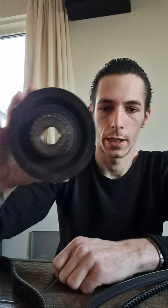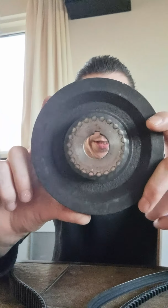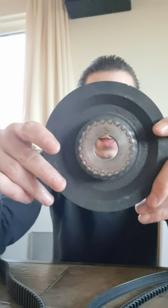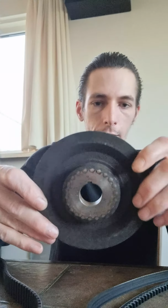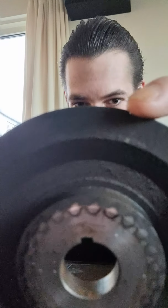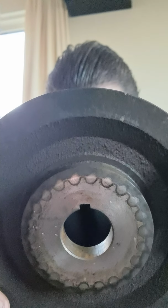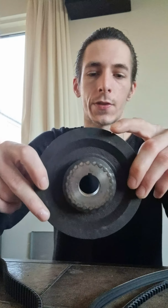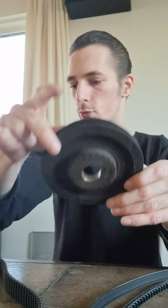already explained in one of my videos, this right over here is my crankshaft pulley. If you guys see this little nut in the center, this means top dead center, okay? And here is a little tiny space. There you can see a little gap, just very little. And that means 0. So this is top dead center, but it was shut down at this. That's 120 degrees. No problem though. I realigned everything back at top dead center.